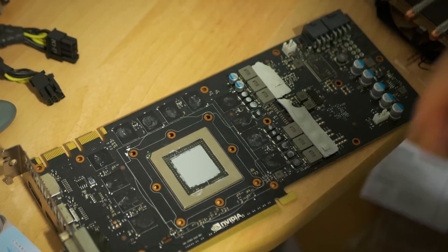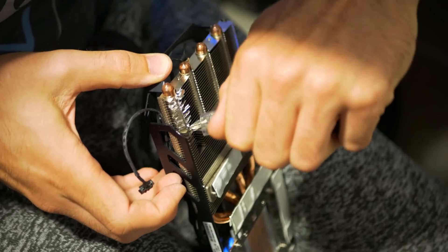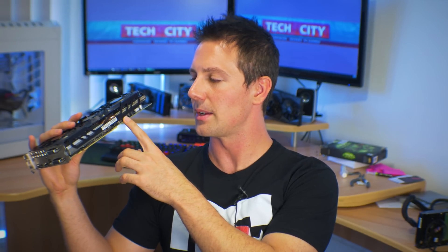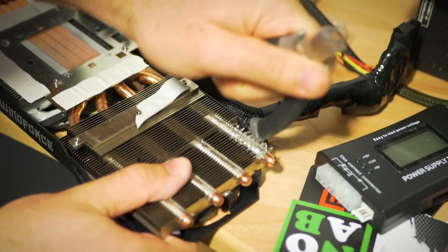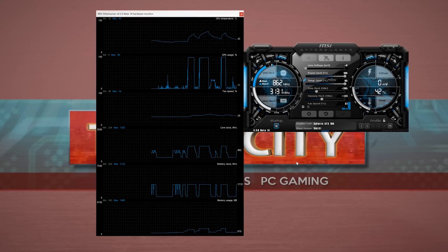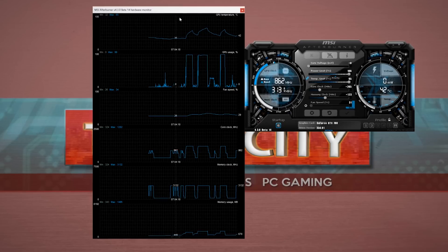What about the GTX 780 that I had here? Well, that got some loving too. I managed to retrofit the 980 Ti Windforce onto it, though I had to cut out some of the fins at the end, and the PCB is now bent a little due to the VRM heatsink not fitting properly. The memory banks lined up perfectly from a 980 Ti to a 780, which means a lot of the design didn't change. It overclocks perfectly fine — I got it up to 1.2 gigahertz and the memory is running cool.